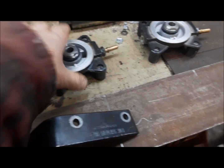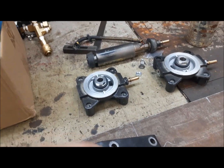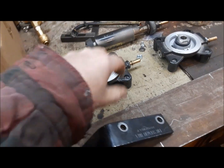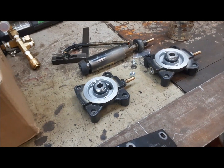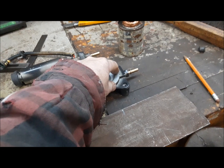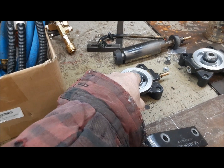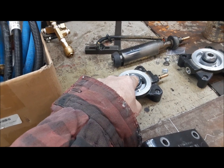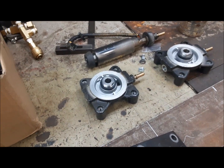Here's some of the stuff we've got kicking around. These are Cummins filter heads — they're 1 inch by 14 threads per inch. They'll take the CAT filter that everybody likes to use, the 1R0750. We're going to be using FleetGuard filters — it's a Dodge truck with a Cummins engine. So we're going to have an FS1001 filter strainer, and then it'll get pushed through an FF5814, which is their nano filter. It filters down to two microns. That's what we want for this engine.